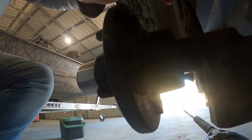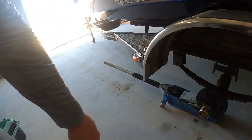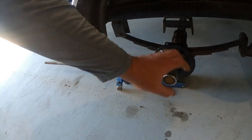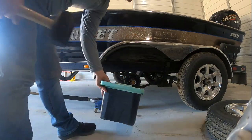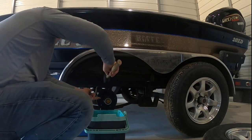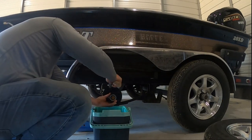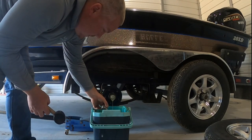As you can see it's a little bit wet here, but this is the seal we're trying to get to — it's leaking oil. These are oil-filled hubs and it's leaking oil out the back side out of the seal. So we got to pull this hub off. We're going to knock this cap off, take the cotter pin out, the nut out, the washer, pull the whole hub off, and pull the seal out. We'll put a little catch can underneath to catch the oil. I'm going to take this rubber mallet and just tap on the cap while spinning it and keep trying to work it out.